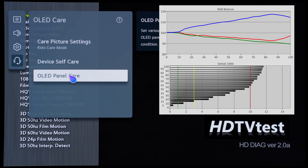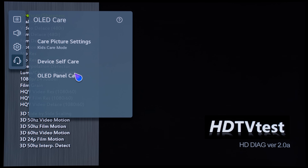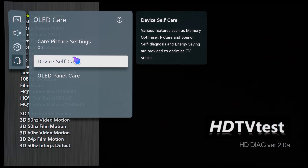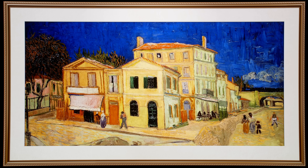With kids care mode, I think what LG is trying to do is set adjust logo brightness to high, because in children's programs there will be some bright logos which may pose a risk for OLED burn-in. So they set adjust logo brightness to high to reduce the risk of image retention and permanent screen burn. But for any video enthusiast, care picture settings should always be off so you can access the picture controls to fine-tune the picture quality on your TV. Now that you've learned how to turn off the no-signal message on your LG C1, you should also turn off three other TV settings which I will demonstrate in this video.